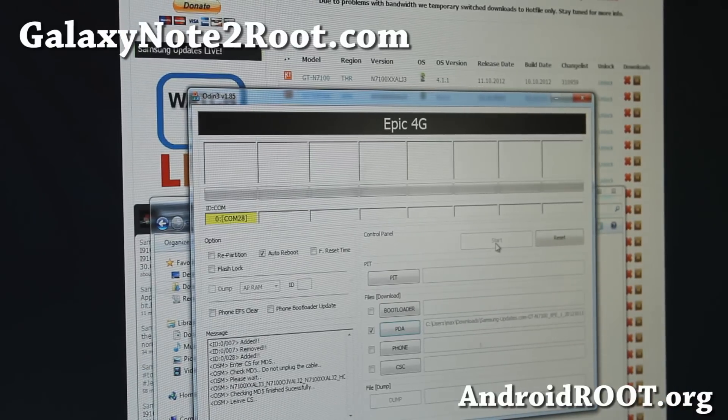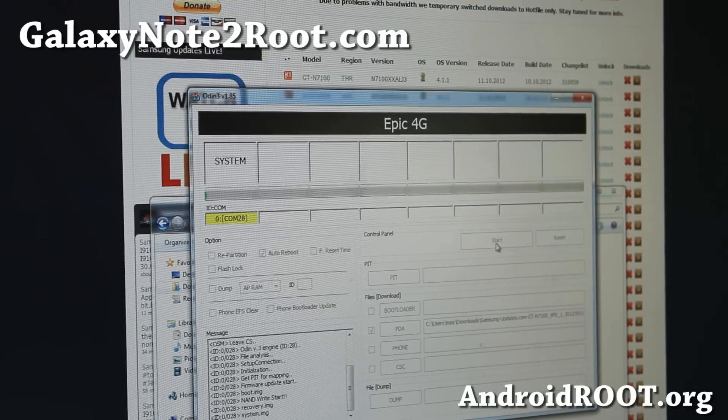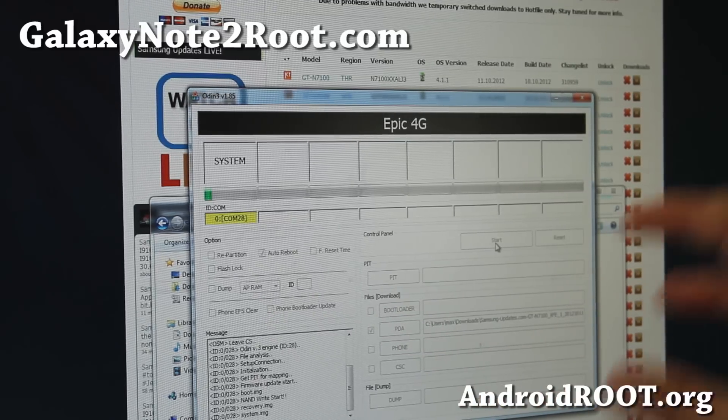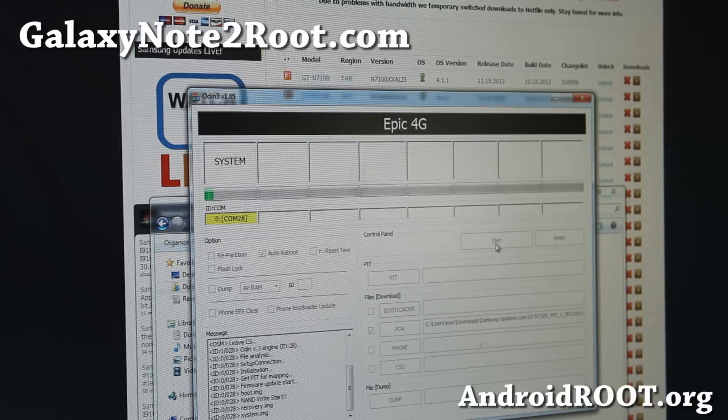If you don't have a Windows computer, you can run Mobile Odin and copy the tar.md5 to anywhere on your phone, then find that file in Mobile Odin Pro. It may need to download additional files in the app but will do it automatically. Also, if you want to reset the flash counter before sending it to a Samsung Service Center, run the Triangle Away app before doing this. If you flash the official firmware this way, it will not increase the binary count — run Triangle Away first, then run Odin, and you'll be on a totally stock ROM with binary count zero.